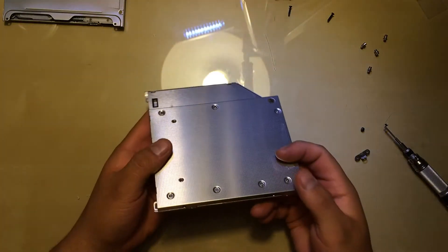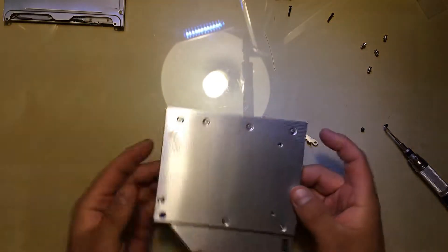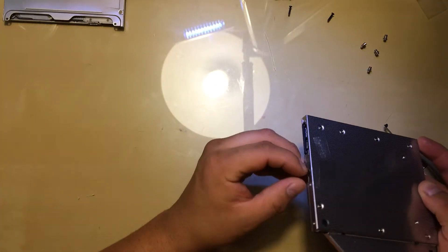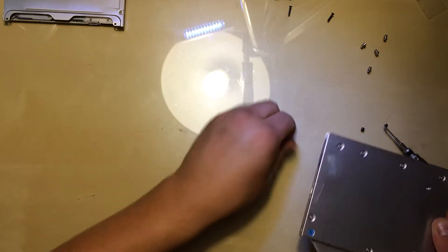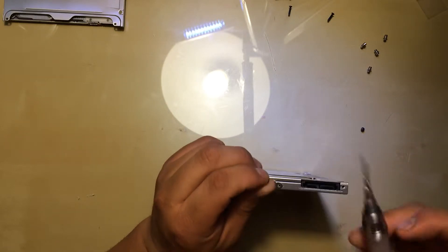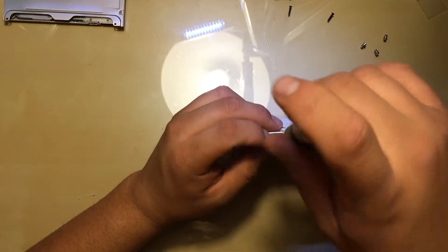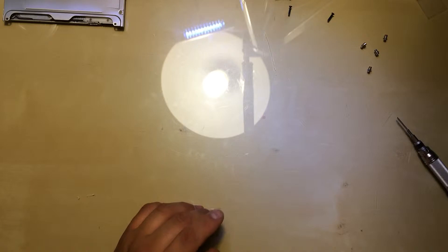In the aftermarket adapter, you see that you have the two holes for two screws right here. What you need to make sure is that you're going to put this facing down — the lower part goes over here. This is the lower side, this is the high side, so like that when you screw this on, it's going to be exactly on the level. We're going to put two screws in — it's really good when you use a magnetic screwdriver. Once you did that, I'm going to put this to the side again.